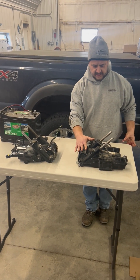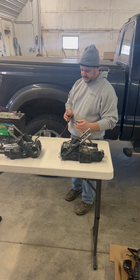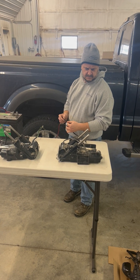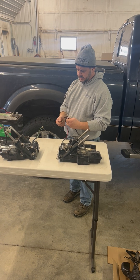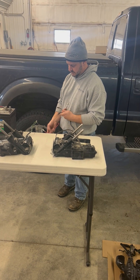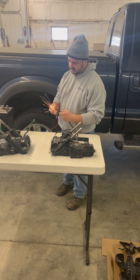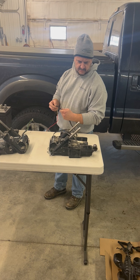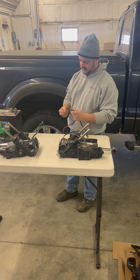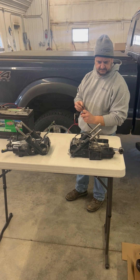This is the 3 Ram 2-wire system, which came out in 1996 and was used on up into the newer models. Here we just reverse these two wires. So that was actually going down. A quick, easy bench test that you can do at home. If you've got a unit off, quickly do that and just double-check to make sure at least the motor is running properly.